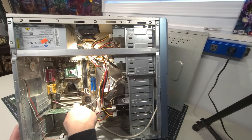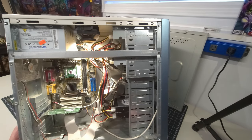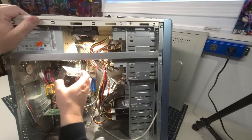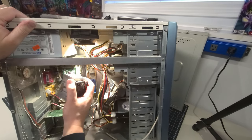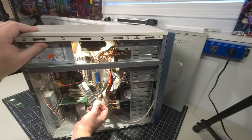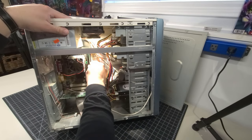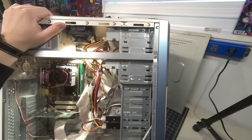The coin cell is interesting the way it's sitting in there, but it looks good. Let's put the heatsink back on — there's enough crusty thermal grease left that it'll be okay for the short time we'll have the PC on. We'll pop the RAM back in and get the bench set up with a monitor, keyboard, and mouse to do the old smoke test.